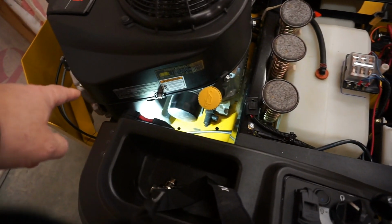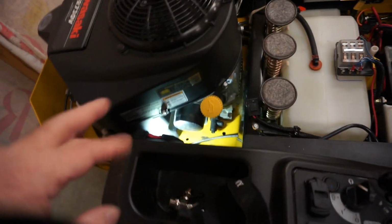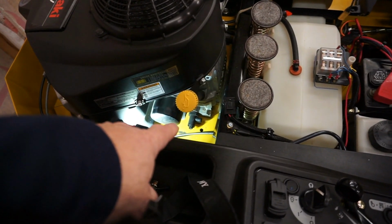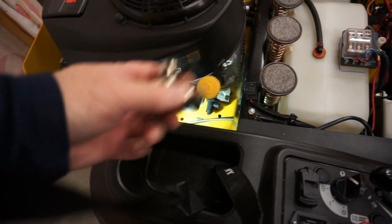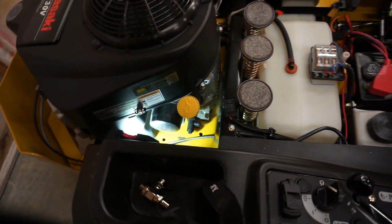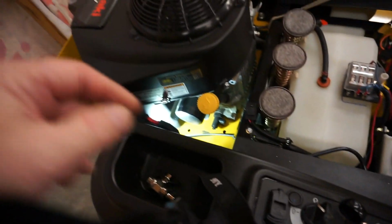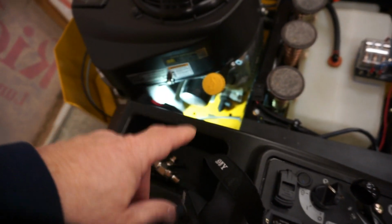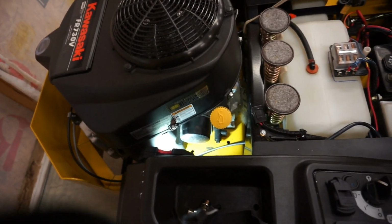just pull the hose out of that bracket, run it down through the frame into your bucket, open the valve, open this valve right here, and then the oil will be allowed to drain. When the oil is drained, you close this valve, and then you close off the valve that you've dropped down towards your bucket, bring it back up through, clean it up real well, put it back in the bracket, and that's where it'll live until you change oil again.